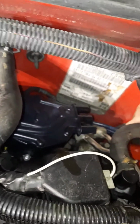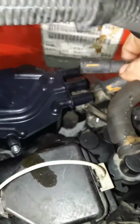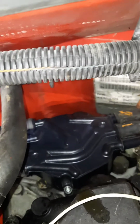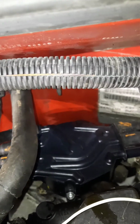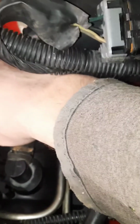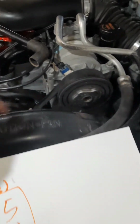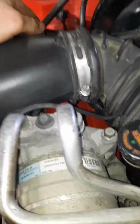All right. Same thing on the other side of the motor. You'll find cylinder wire 1, 3, 5 in that order. But when you get back here, they're not in order. So pay attention. Remember, 1 is in the middle, 5 is all the way at the back, and 3 is at the front. All right. So you got 3, 1, 5, and then you got 2, 4, 6 coil. If you did everything right, it should be ready to fire up.